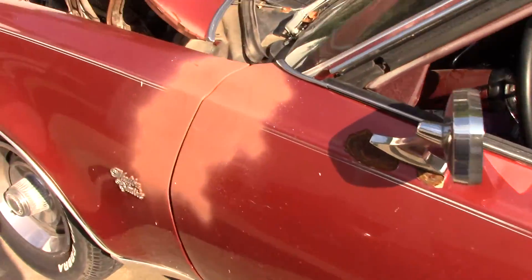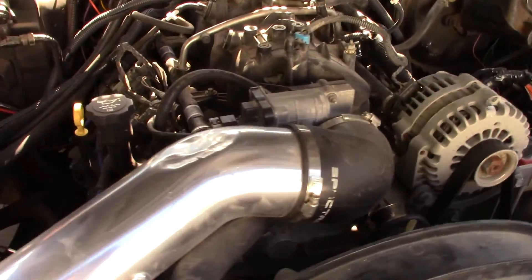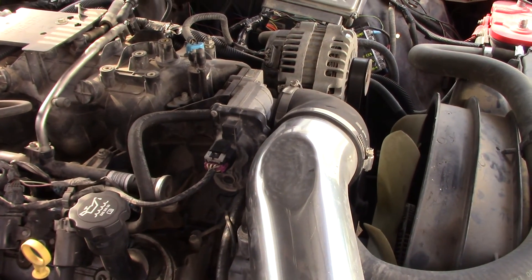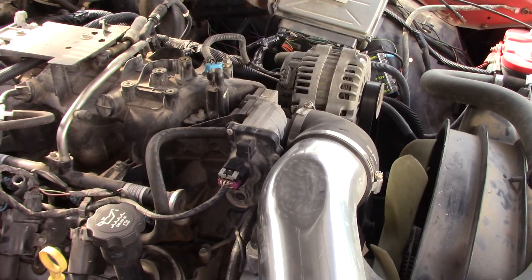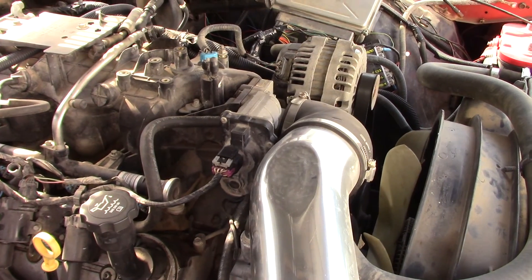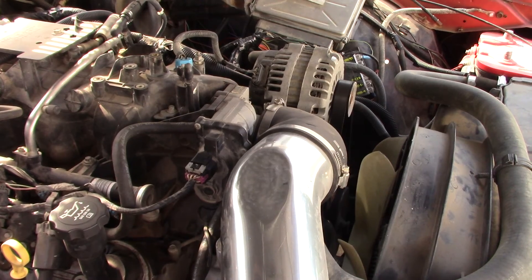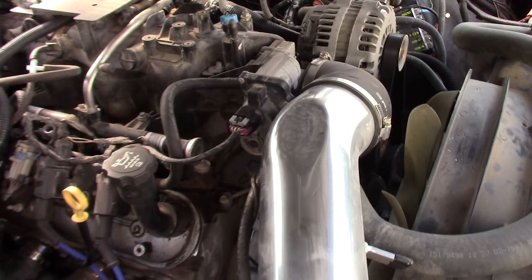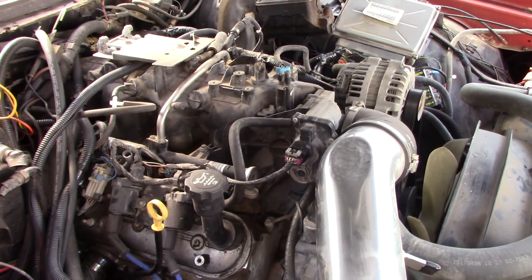I'm going to get off here now. Hopefully on some of the next videos I'll actually show you swapping out the throttle body — it's either the harness or the actual throttle body, so I'll swap it with the one I have and see if that fixes it. I may do a how-to on that: it's not a big deal, you just need to mind that your coolant goes through there so you have to plug that off, but it shouldn't take long. Then I'll try to get set up a little bit better, since my last attempts ended up not being good enough to post. Anyway guys, talk to you later.